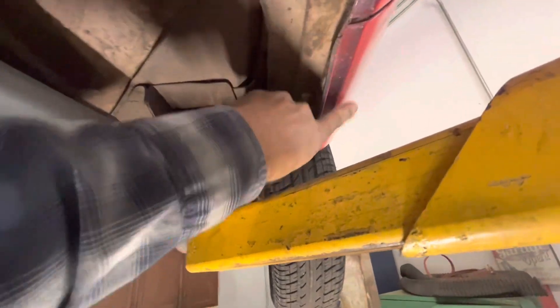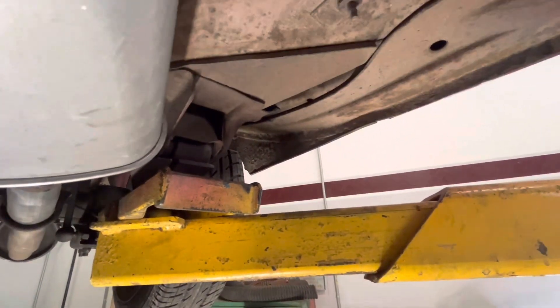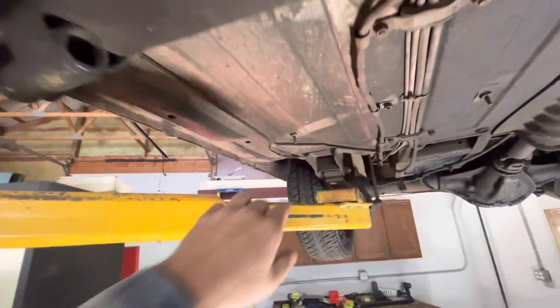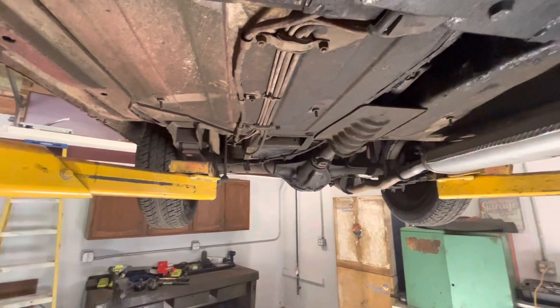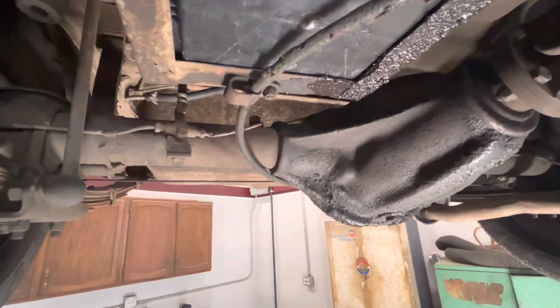This is where you really need to look at them — especially back in here. The rubber bumper cars will tend to rust right in this corner first. They didn't do quite as good a job sealing this corner on the late cars. Looking through here, that all looks factory and clean on both sides. I don't see any evidence of any rust repairs done. Everything looks factory, still has the factory bolts holding the seats in. I think this is actually a genuine rust-free car, which is a good thing because rust is the number one enemy, especially in this part of the country.